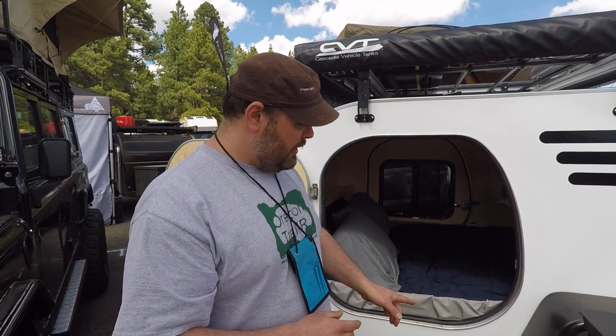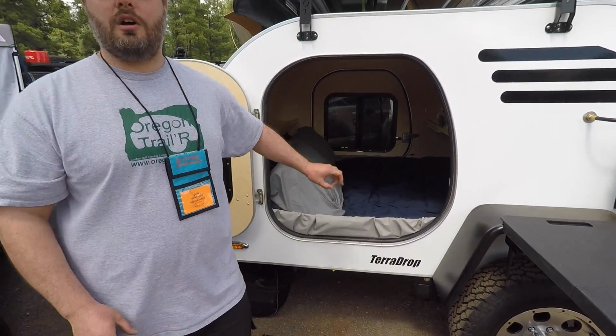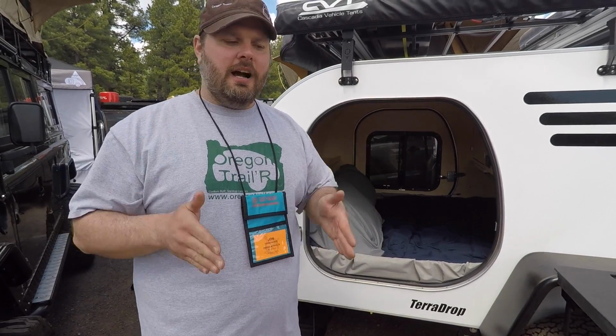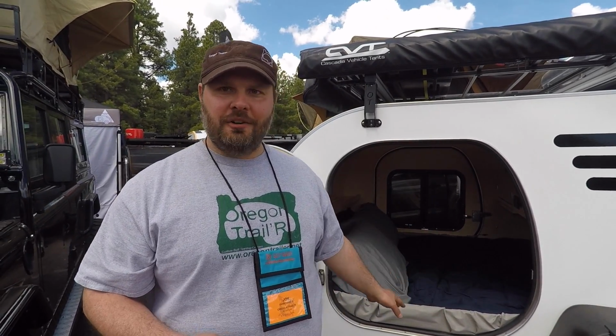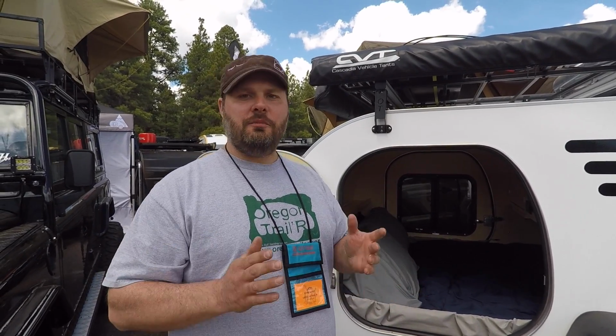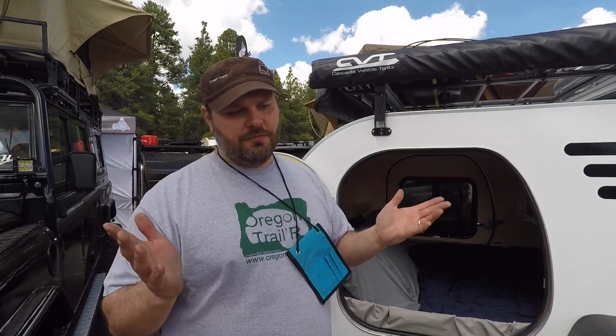We always tie them together with a center string, so right where this little square is here, there's a beam that spans across and keeps them perfectly in line and keeps them from splaying and all of that. It takes a little bit of the ground clearance away. However, most vehicles don't have as much ground clearance in the first place. So if you hit this, you've also already hit other things. So for us, it's well worth it to take that space and make this thing a really strong, really stable package. Self-aligns. It's far worth it.